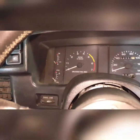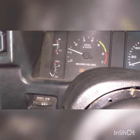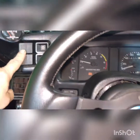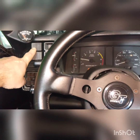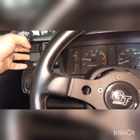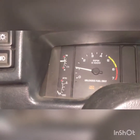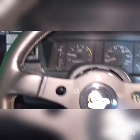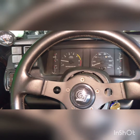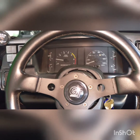And we'll see the voltmeter. Yeah, it's really up there. I'm gonna turn the headlights on. It bounced but it's right back up. So that was a 6G alternator out of a Ford Taurus — seems to be working good. I'll keep testing it. If I see any problems or you guys have any comments, let me know, and if I see anything I'll update. Thanks guys for watching, bye.